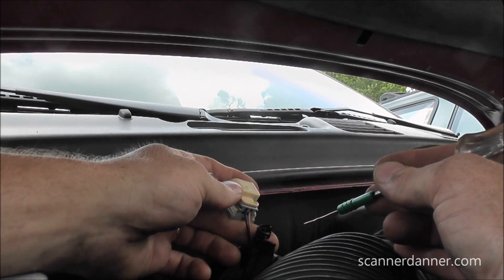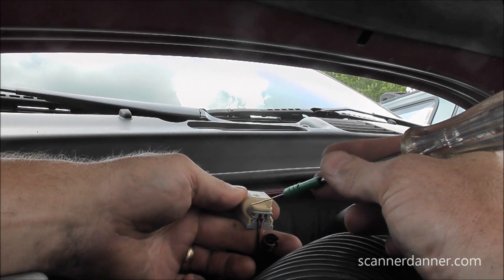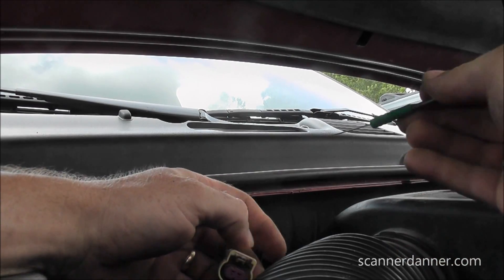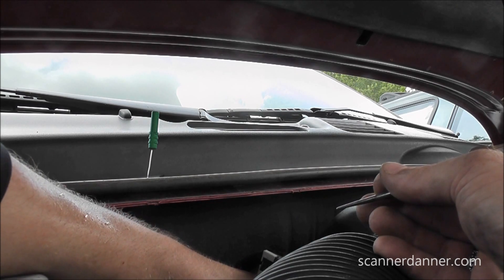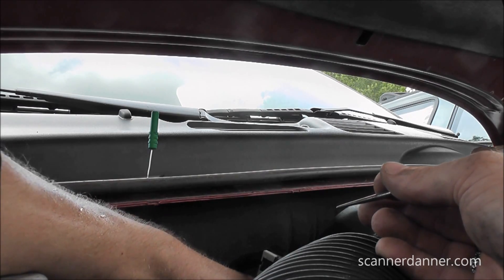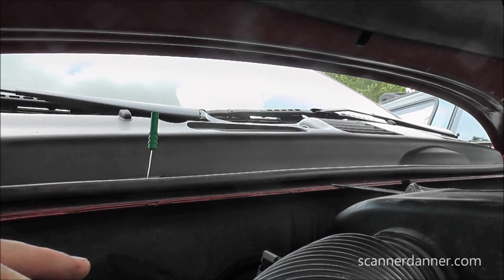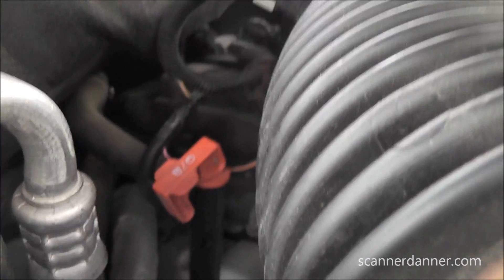So let me ask: do we have everything we need for this solenoid to turn on? We have power - but only when the pump turns on - and we have a constant ground. The answer is yes. So is this diverter actually opening? I'm saying it's not, based on the sound of the air pump. It sounds restricted. When I disconnected that line you heard the volume of air flowing freely, and more importantly the pump had much less stress. Let me do it again so you can hear the difference.